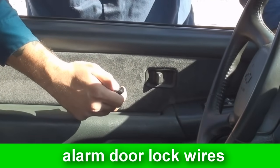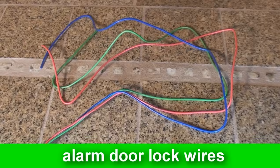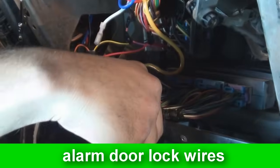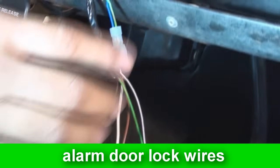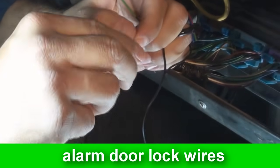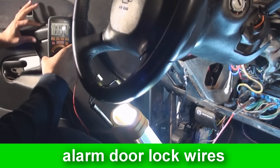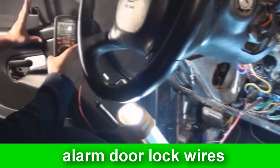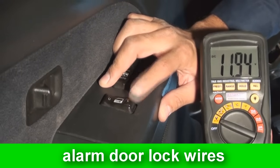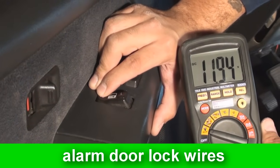When the lock or unlock button is pressed on the remote, these wires when connected will send a pulse to your door locks telling them to lock and unlock. Normally the output on these wires from the alarm are negative outputs. Check your tech notes to see what polarity your vehicle's door locks need to activate. Most common are negative pulse and positive pulse; others include reverse polarity, single wire, vacuum locks, and data control locks. If your vehicle locks are something other than negative, you will need to prep the door lock outputs for such door locks. To test a positive or negative door lock circuit, make contact with the lock wire and hit the lock switch on the vehicle — the circuit should trigger to 12 volts or 12 volts negative depending on the door lock system. Once the circuit is verified, integrate into the circuit. Test the unlock circuit by making contact, hit the unlock switch on the door, and it should change voltage just as before. Once verified, integrate into the circuit.